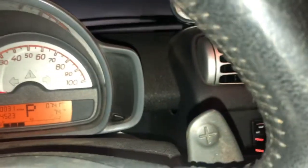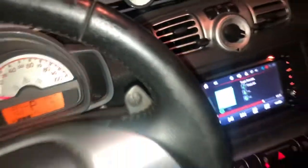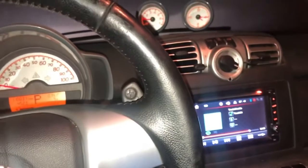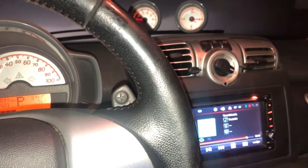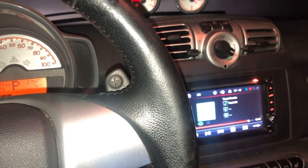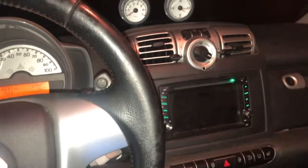Our engine light is fixed. I drove it for about 100 miles and there are no more codes. So if you want to fix a P0451 or P0452 engine code for under $20, this video is for you. I'm going to have a photo of all the cross-references at the end of the video so you can freeze the frame and look them up. You can get the part on Amazon for anywhere from $15 to $40. You don't have to pay $160 for the fuel sensor. Thanks for watching.